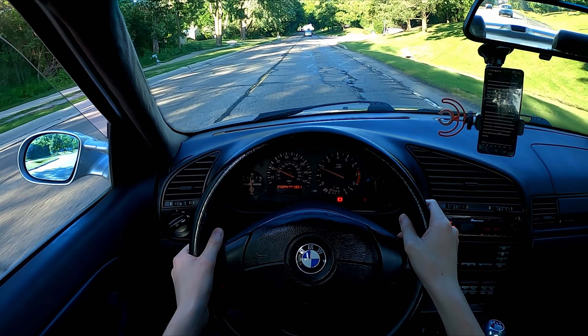This is my daily driver, used even in winter. Cold braking performance was very important when I was researching. In the real world, cold braking is slightly worse than factory pads, but after a few brakes they're just as good as stock. Below 50°F, especially in the low 40s, you should warm them up before aggressive driving. Above 70°F, they warm up within two to three minutes with zero effort.